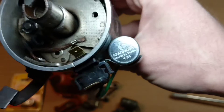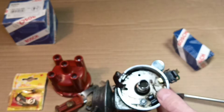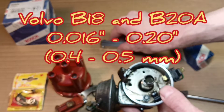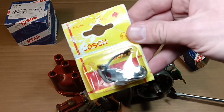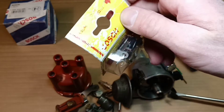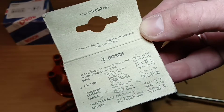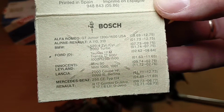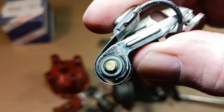If you're not confident in your condenser, it's better to replace it. A new Bosch condenser will cost around ten dollars. Now let's adjust the contact gap — for this I need a feeler gauge. The price fluctuates according to quality. I'm sure these contacts will last a long time. Look at the part number — these contacts can be used on earlier and later distributors with the B20 engine.